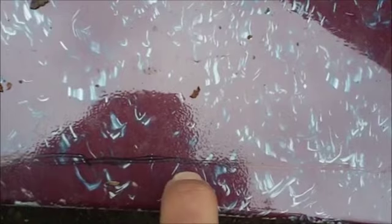So, I don't know if you guys can see it, but there's my line. It fades away and comes back again. There was some water on the panel, but I can see it. And what I do when I cut this out is I just use my cutoff wheel on my angle grinder, my electric one, and I'll cut right about to where my fingernail is.